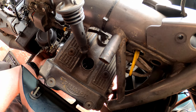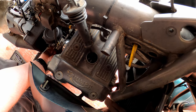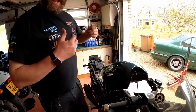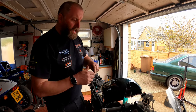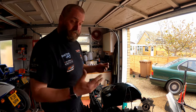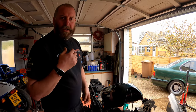And there we go — that is the last one. A nice Bunsen blue. And as you can hear, the engine just sounds smoother. We're not getting popping from the exhaust anymore, so I'm happy that the carburetors are doing what they need to do. The sound of the engine is much smoother.